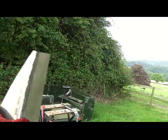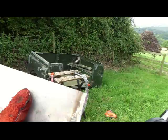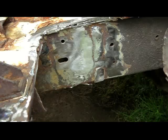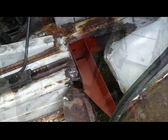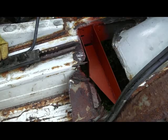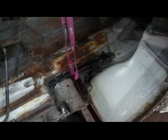I've just welded it up, made a bit of an outrigger, and just ground the welds back a little bit. Yeah, not too bad. We'll see if it fits - quite well in there actually, so we'll get her on there. Looking good. I've just fitted my new outrigger and I'm just waiting now for the new step and inner arch to come so we can start welding it all back together again and put a nice new floor plate in. So far looking pretty good.